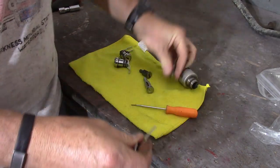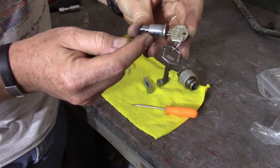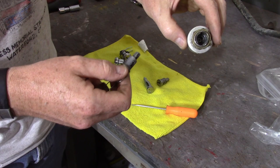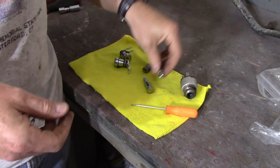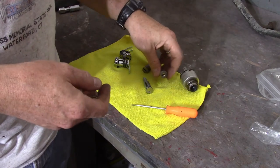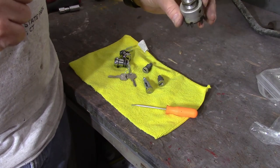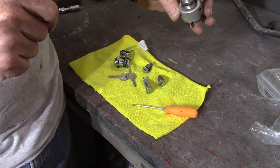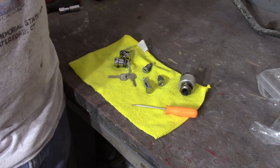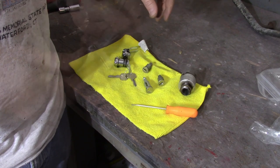If the key does not match, you can see that while it's smooth on the top, it's sticking out on the bottom, and that prevents you from rotating inside of here. But now that I've got a matched key set, I'll be able to use that and replace the key. I'm going to pop the ignition out of the car that's in there — I just wanted to make sure that's really what that hole did before I tried it on mine and broke something. Now I'll pop that key out and replace the tumbler, and then I'll have to get the hood latch and boot latch thing off.